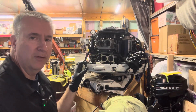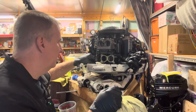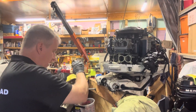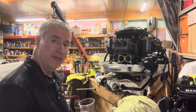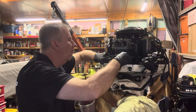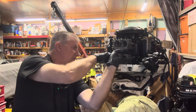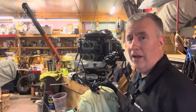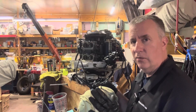It might have made better sense to put the bottom one on first — that's just the one I grabbed. I also mentioned when we pulled this apart I was going to put the lower unit on so I could see better to hook up my shift shaft. We'll figure it out. I like this Allen key that has the ball on the end because I can work it at a little bit of an angle. We did flush out the fuel line. We'll put a few new tie straps on this and make sure it's connected to our fuel setup, then hook up our fuel tank with our squeeze ball and pump it a couple times to make sure there's no leaks before we put any covers on.